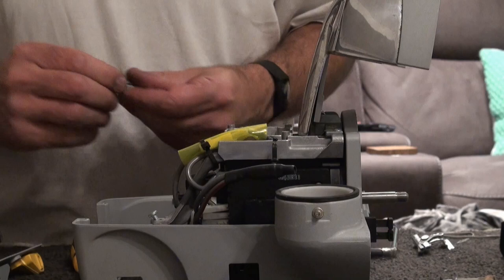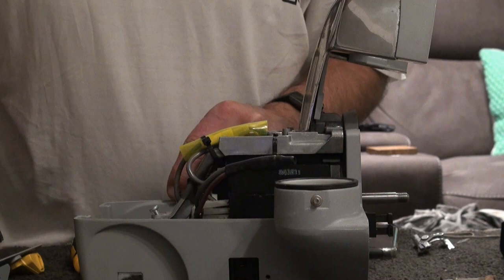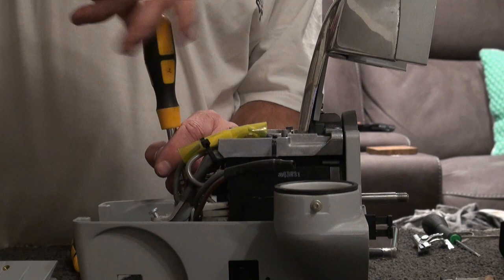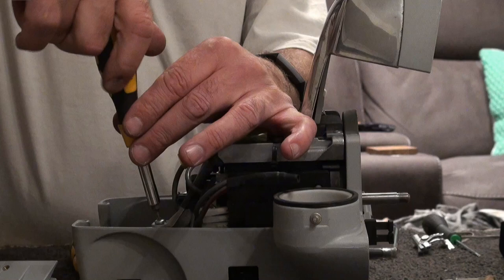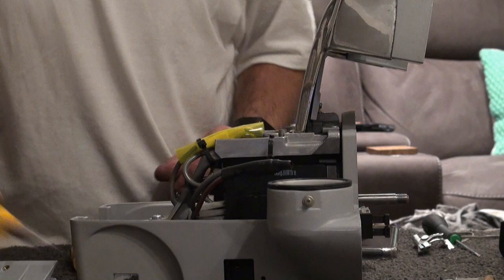Because we've got to put the front casing on, so we'll put the fan on. Then we'll tighten that up. Turn the short bolts. So, again, try not to thread it because these are just into aluminium. Put a bit of torque on them. Some people use ratchet drivers. I don't like them because they tend to round it off. So I just prefer hand screwdrivers.